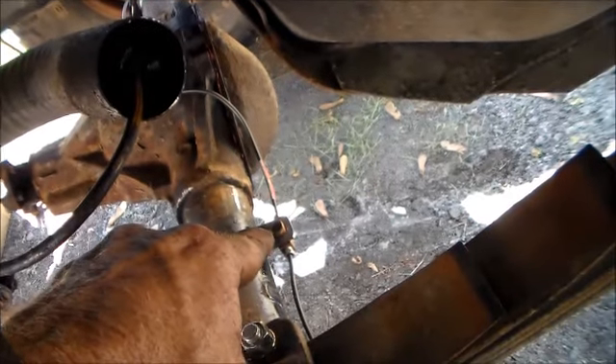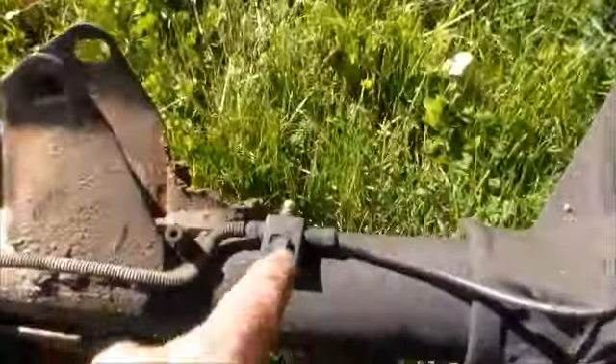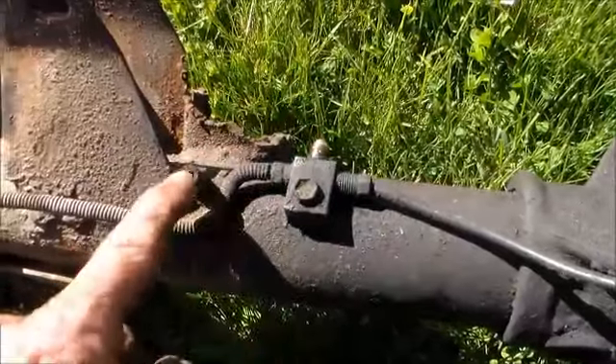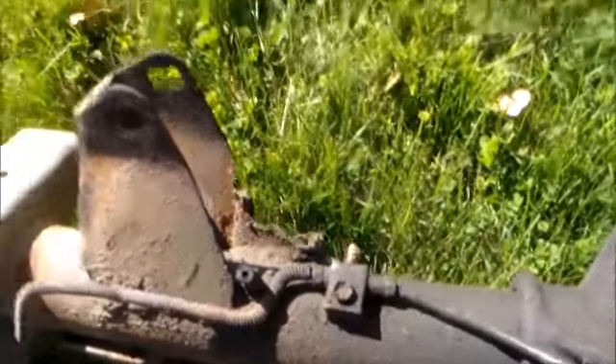And I'm going to have to get the flex hose for the brakes in the rear, which runs into a T — which is that piece right there. I've got to take that piece and this piece right here off. This piece right here fits on that one under a Jeep now. So I might end up going to a Chevrolet pickup truck — they've got a '67 down there. I'll get the brake lines and I'll get the T off of that. That should work.